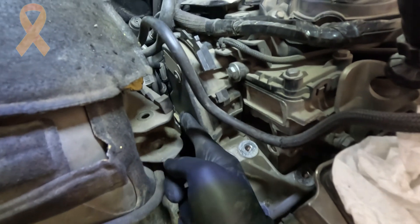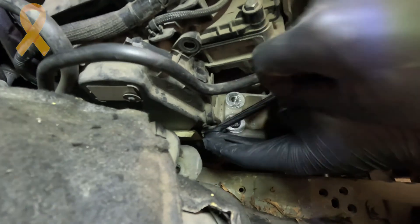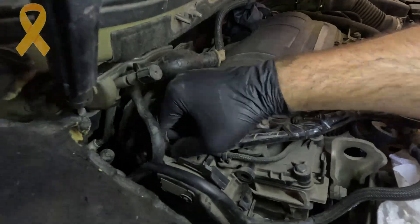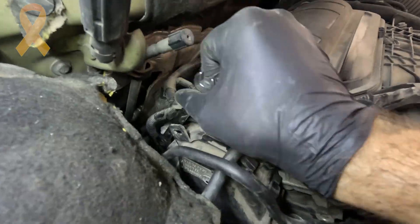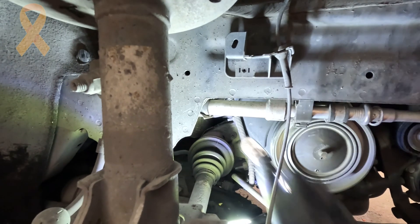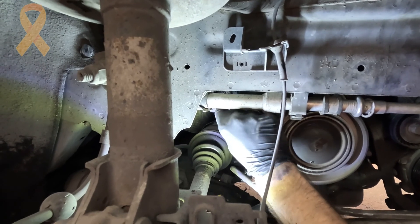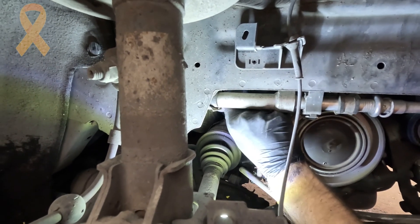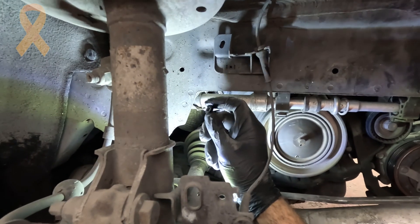This is so narrow I can only put a finger between the engine and the bracket. The upper timing belt cover comes apart with a few bolts with 10mm heads. The tricky part is not removing the bolts — which requires all kinds of different tools and extensions — but disconnecting the clips of the harness that is connected to the cover. There is really no access to see the clips and you have to work with a lot of patience until it works.